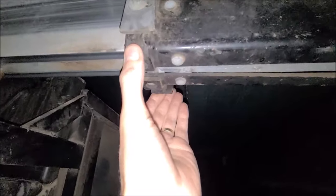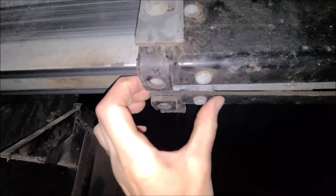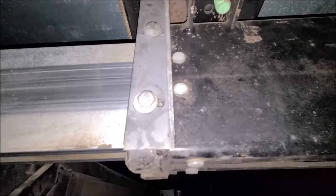All right. Yeah, we are getting closer, aren't we? Now here's a good view of some bearing damage. See how badly it's broken out right here? Because the bulk of the weight comes out on these two front bearings. The rear ones seem to do okay because they're not handling the load like this front one is. So we're going to get this little pry bar right now, see if we can't push this over to get this bearing out. We'll see if that will work for us.